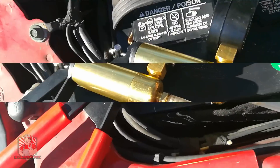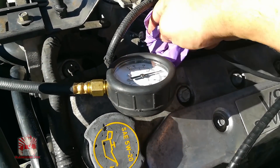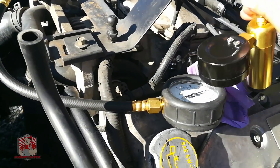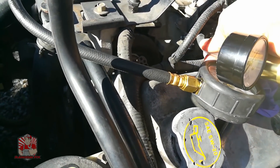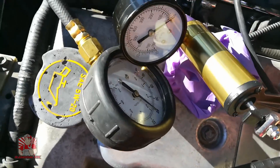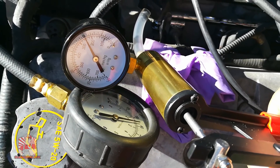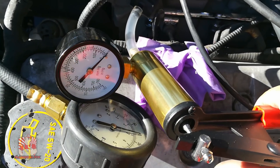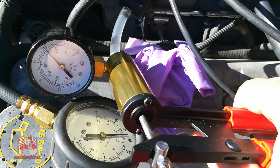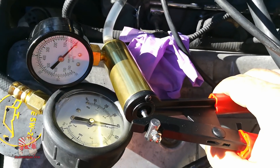I'm going to show you guys how to test this using a vacuum gauge. I got that sealed up so that's not leaking out, and you can use this vacuum gauge just like that. Keep an eye out on this — watch when I increase the vacuum on the fuel pressure regulator, the fuel pressure actually goes down. So when I raise it up really fast you can see that happen. Always keep an eye out and make sure you have a good functioning fuel pressure regulator.